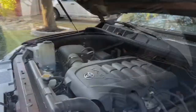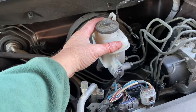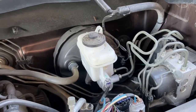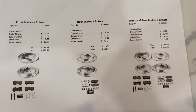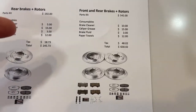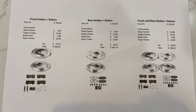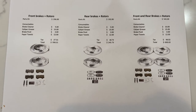Test drive complete — I performed the break-in procedure. If this completes your job, go ahead and top off your brake reservoir with DOT 3 fluid. This video covers the rear brakes; a separate video covers the front brake replacement procedure. Cost breakdown: rear brakes including parts and consumables run about $250; front brakes a little over $350; getting the kit for both front and rear together with consumables runs just under $650. If you enjoyed this video, click that like button and subscribe to the channel — thanks very much.